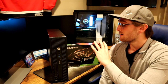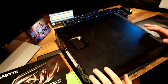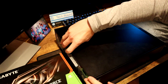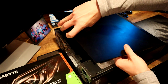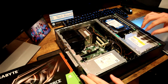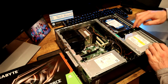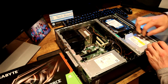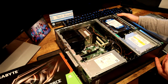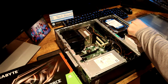So we'll go ahead, take the system apart, and install our GTX 1650. When tearing down the HP Elite Desk 800 G1, all you have to do is lift up the lever on the back of the side panel and it comes right off. For access to the DVD drive and hard drives, you'll want to take off the front plastic panel — there are three little tabs on the front you just lift up and the front panel falls off. There are also some hook tabs on the bottom you'll need to work with carefully so you don't ruin them.